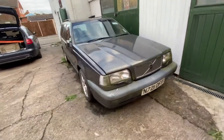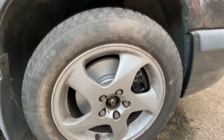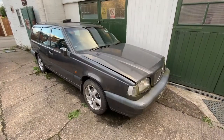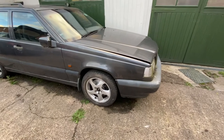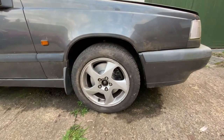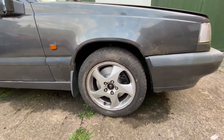The car's back on the ground. We have finished assembling all of the suspension, driveshaft, and brakes, and the wheels are back on — that properly fills the wheels. There are still a few bits to do. Unfortunately, the new bleed nipples for the calipers weren't quite the right size — the right thread, but not a long enough thread to properly seat. So we're going to have to take the wheels back off and replace those at some point in the near future.